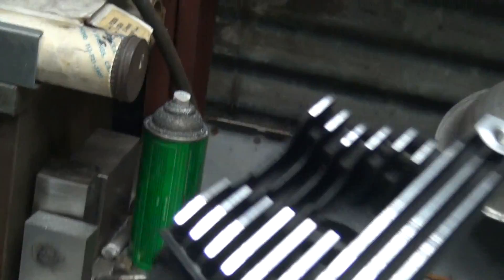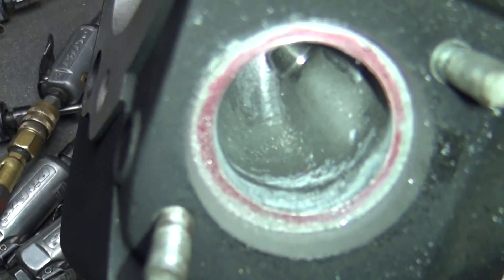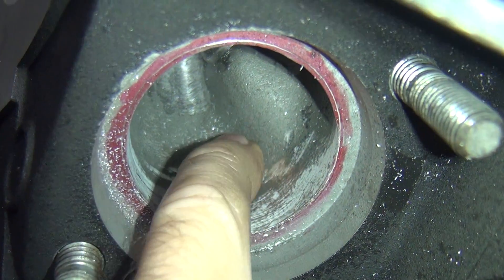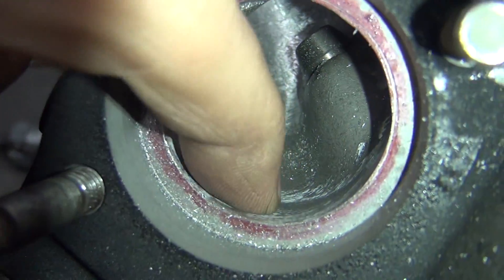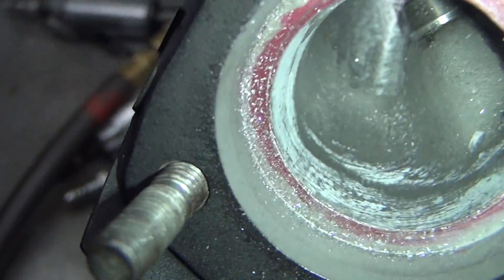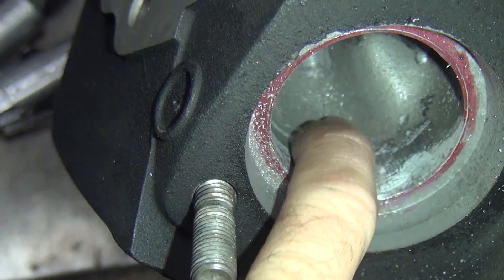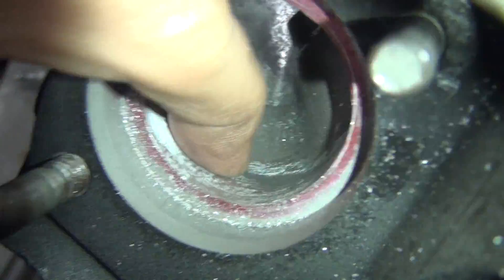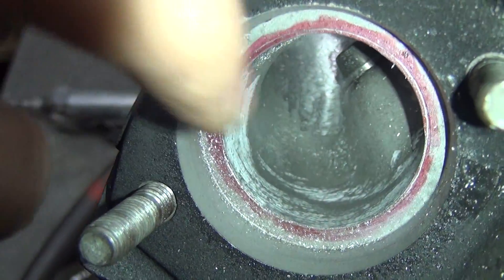You can see how we're just kind of lightly blending it in here — we're just trying to make it smooth and even to bring it out to the gasket surface. Take away the roughness. You can see we're not really cutting all that much, just kind of out here on the outside blending. There's a little bit of a pocket right there where my finger is — we'll blend that in and that'll be pretty much it.